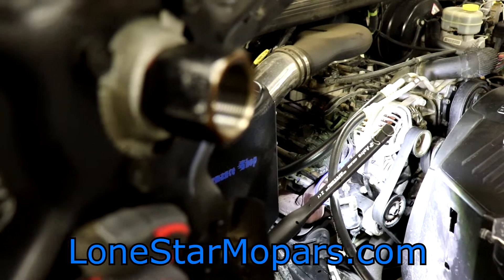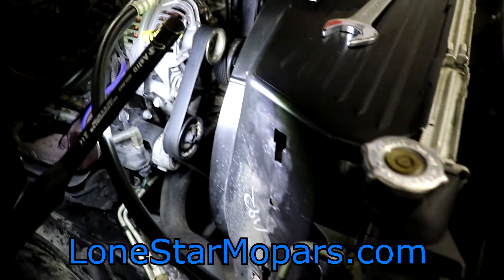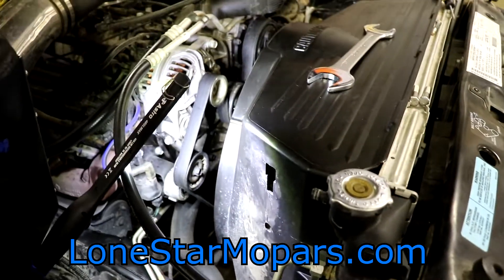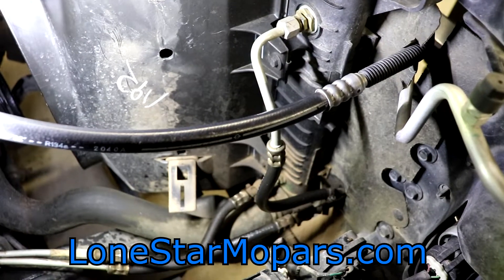When I reassemble everything you're going to see a glob of silver — that's anti-seize. Do like I do, you will thank yourself, and if you don't, whoever has to pull this fan off next time will say, somebody took this off and put anti-seize, they rock — and that would be you. So we're freeing up space. I'm going to set this down and showcase those four 10-millimeter bolts, get that out of here, and show the water pump.